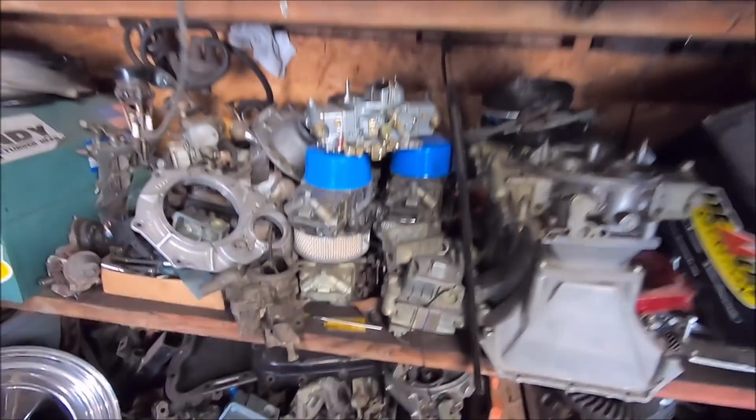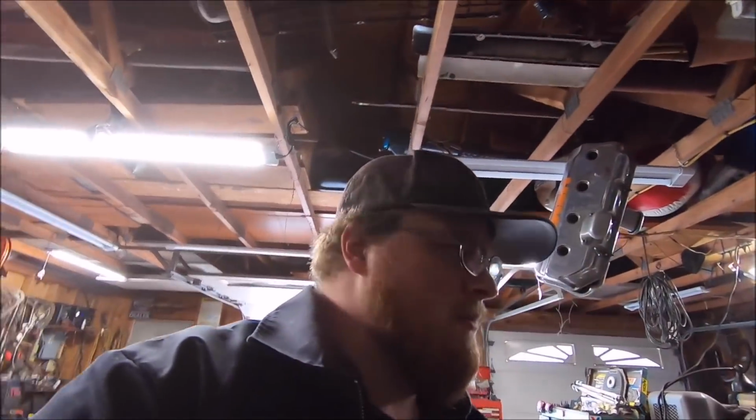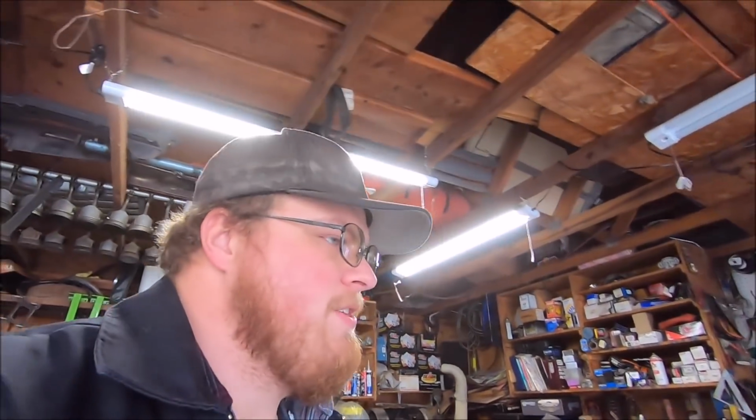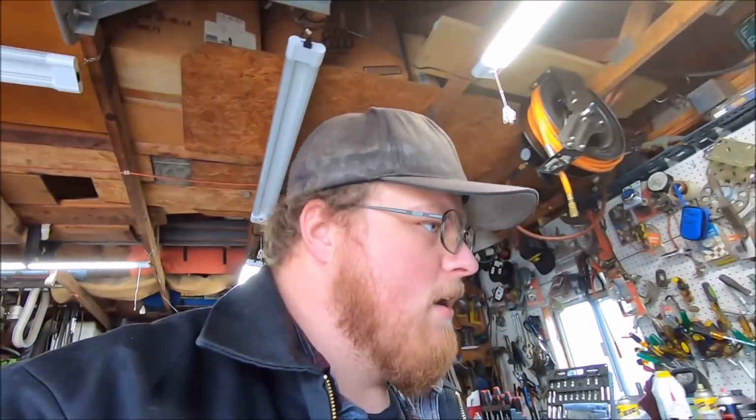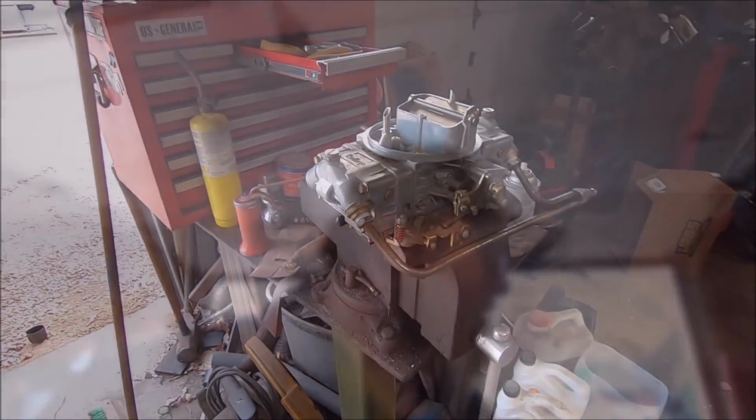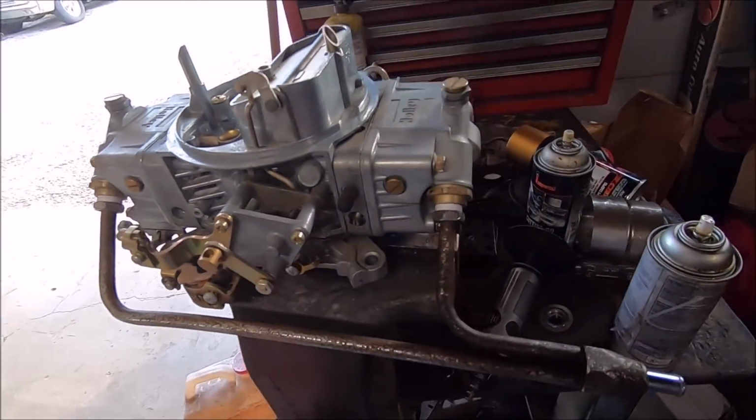It's like brand new. But carburetor's on there, works pretty good. A little snappy. We're gonna lower the jets down a little bit if they ain't too god-awful huge. So I'm gonna do that. I'm gonna go through this thing pretty fast. I'm gonna shut the door, probably turn the space heater on, and feel my fingers again, because I like feeling my fingers. Well, there's the carburetor rebuilt.